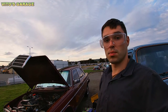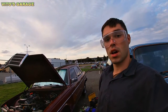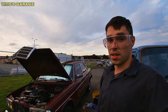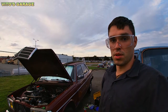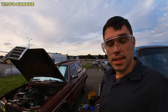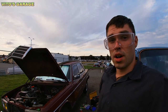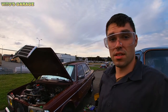I'm going to be talking about the engine oil cooling lines. The problem with this car is that one of the engine cooling lines — the actual rubber part — is rubbing against the body, which is really bad, especially because this engine is diesel and has a lot of vibration. I've seen it multiple times where not only engine oil cooling lines are rubbing against each other or the body, but also AC hoses rubbing against each other or the body. That wears them out and can cause really big problems. So whatever car you have, open the hood and check all the lines — make sure nothing is rubbing against each other. It's a really big deal.